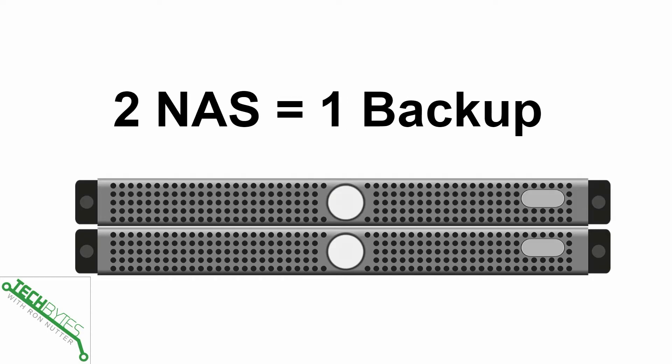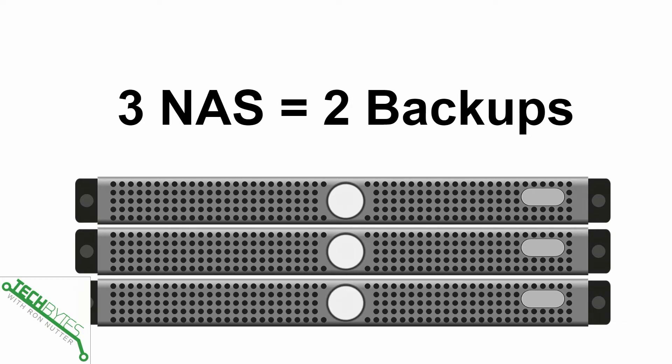When you've got two NASes, that puts you in a different situation, because now you've got a level of redundancy — you're insulated from motherboard failure, power supply failure, and multiple drive failure. If you can go to three NASes, now you've got two backups, and that's when you want to have a discussion about whether to have one of them remote — which is not a bad idea. You can put one in the cloud, but there are costs associated with it. Alternatively, if you offer to pay for someone's internet connection, you can put a server at their place, so if you lose both NASes at home, you still have a third one.